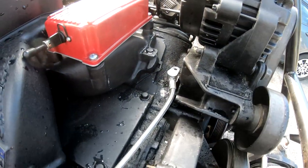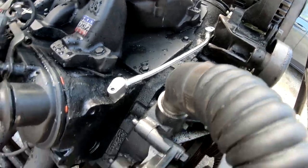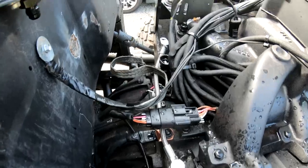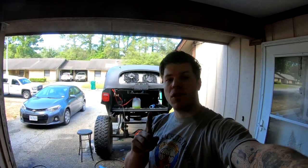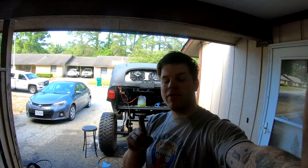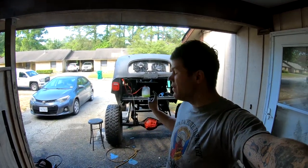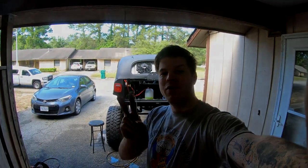Here's how the crossovers look — pretty easy to do as long as you get the o-rings in the right spot. Some pipe thread, some o-rings, did one in the front and one in the rear to help those hot cylinders. That's cooling done on the 38 sedan. We're going to finish up fuel next time — waiting on a 130-micron filter to come in — and then we're doing wiring. Once all three are done we're going to be idling in place. Pretty exciting.